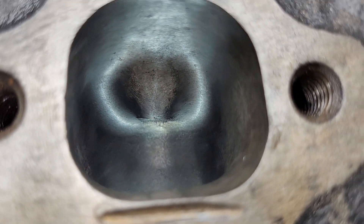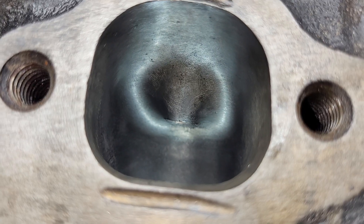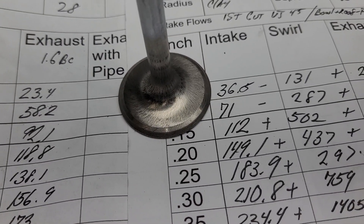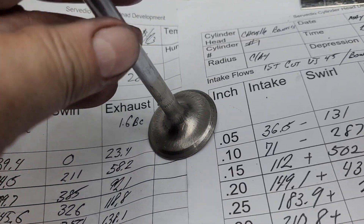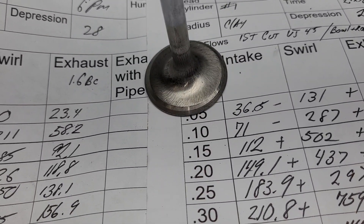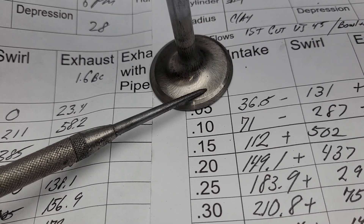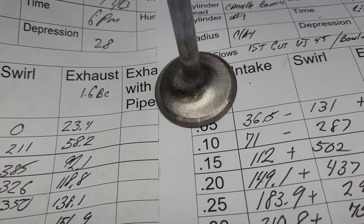You can see my 90s porting — there are still some lumps and bumps in there even though it was gone over with a cartridge roll. Learning curve porting is going to be lumpy and bumpy sometimes; you can only do what you can do. Obviously I'm better now. What I'm thinking of doing on the exhaust: I have a set of these valves — these may even be the original Chevelle valves — I back cut them a hundred years ago. What I might do is recut the seat, recut the back cut, and then use a stone to machine the head away and make it more like a tulip. Then reflow it and see if this port likes more of a tulip shape — that would be an interesting experiment.